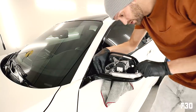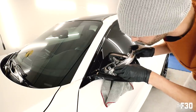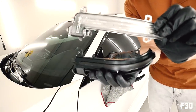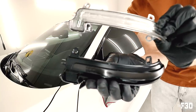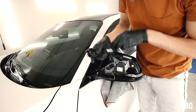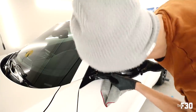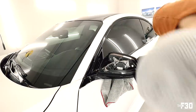You do want to take out those three T10s on the inside because those are holding the clip in. Once you do that, the whole assembly should just come right out. There's the old one and the new one — I like that the new one is all blacked out. We're doing the black and white theme and it just looks way more sleek and modern. Let's go ahead and plug this in, tuck that part down there. The fitment is really good, and now we can go ahead and put all the T10s back in — one up here and three in the back.